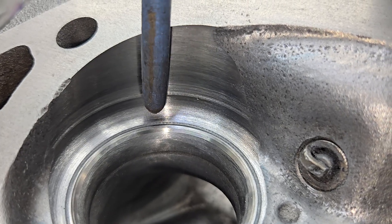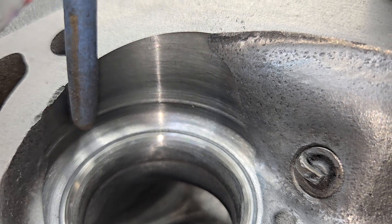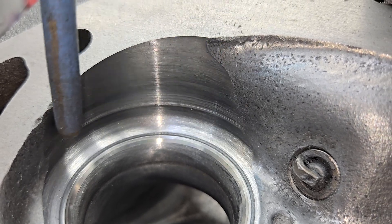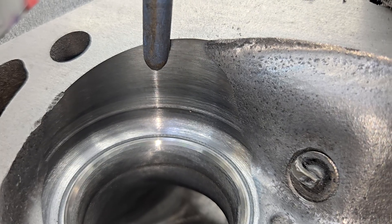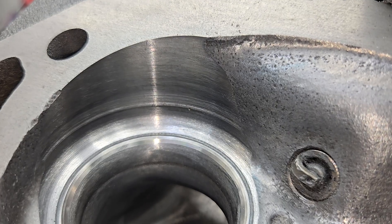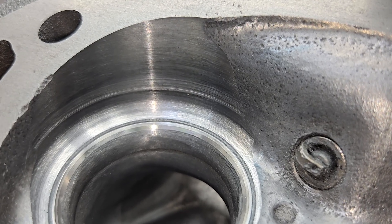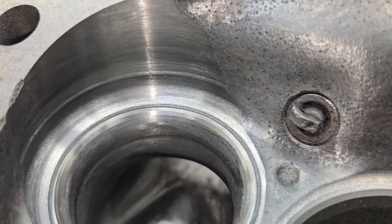On the last one you can actually see where I haven't even taken the last stone all the way down yet, because it's this much of the chamber. Now somebody's going to say I screwed that up — I measured this wall to the edge of the valve and it's within a few thousandths of the one all the way to the right.